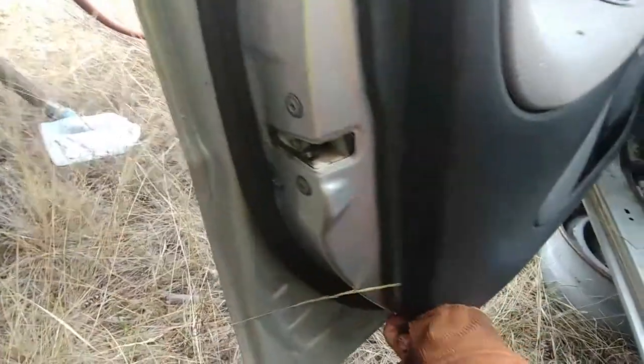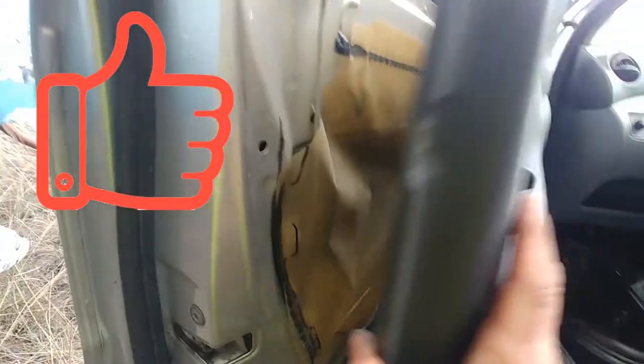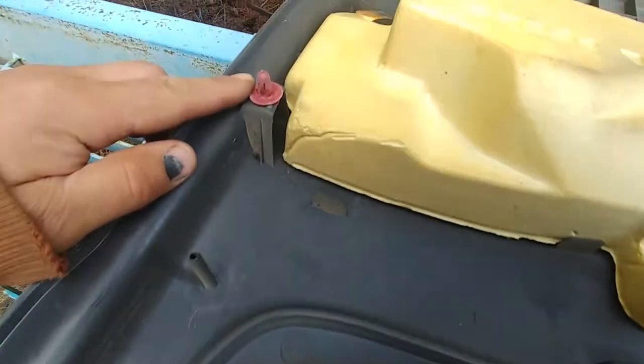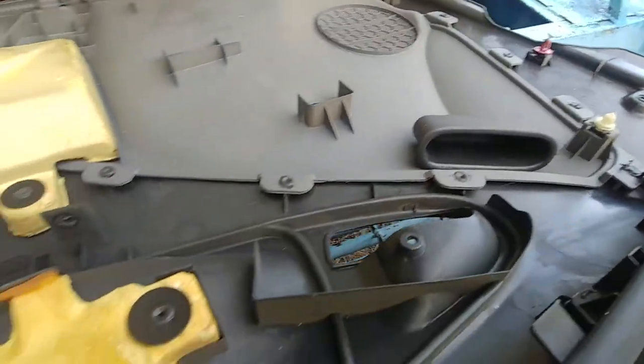Be careful, don't scratch the panel. Now we pry the door side panel — there are clips and it will come out. We removed all fasteners; now it's just on the clips. Pull it like I'm doing. Remove that mirror cover — same, one clip — and the panel is free. You can see plastic clips all the way around; the bottom one was broken — they break sometimes.